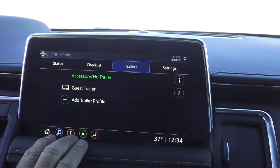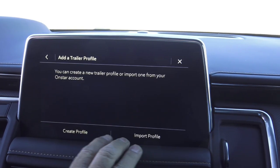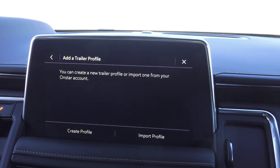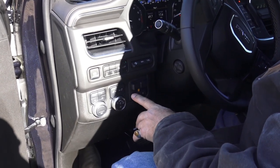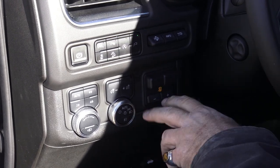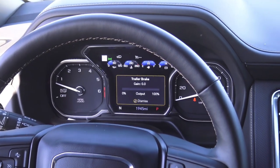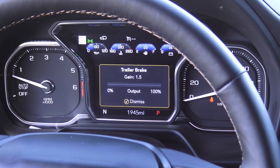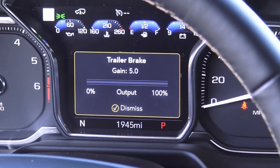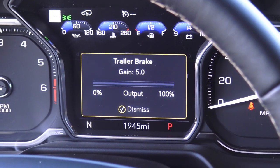There's a trailer profile option — it recalls the gain. The brake controller is on the left side in these GM SUVs; the trucks still have it on the right side. There's your manual override. I'm going to set the gain — I'll go plus. The truck came with the gain set on zero from the last person. I'm going to take the plus and minus and jump it up. Gain two, gain three. The trailer has new brakes — we just had Jayhawk Trailers put new brakes on my tilt trailer. I've got it set at 5; looks like I can get 100% when I push the manual override.